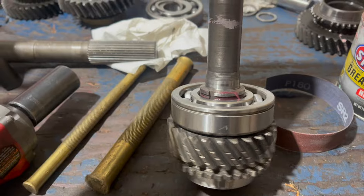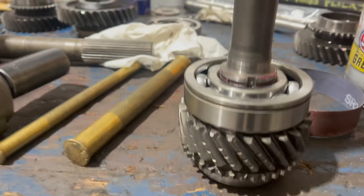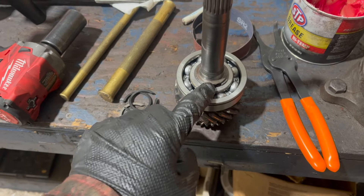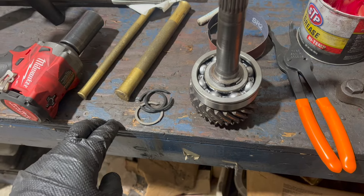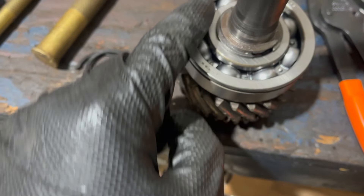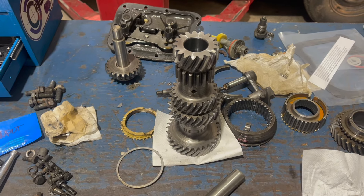Pressed in place. Now I need to go through the collection of snap rings they sent with the rebuild stuff and find whichever one fits that groove the best. I'm not going to film myself installing these lock rings because the amount of profanity would get me demonetized, but what worked for me was starting this end in there and just kind of walking it around.